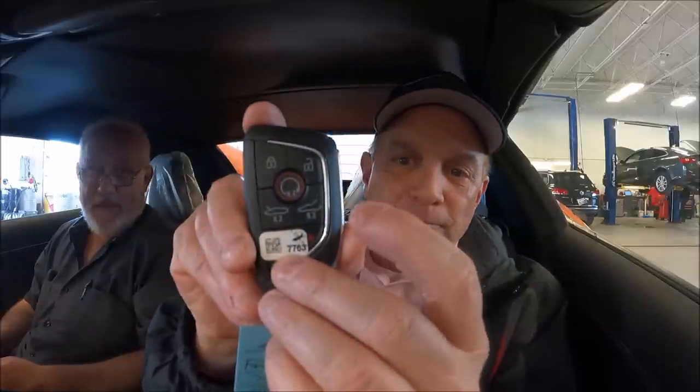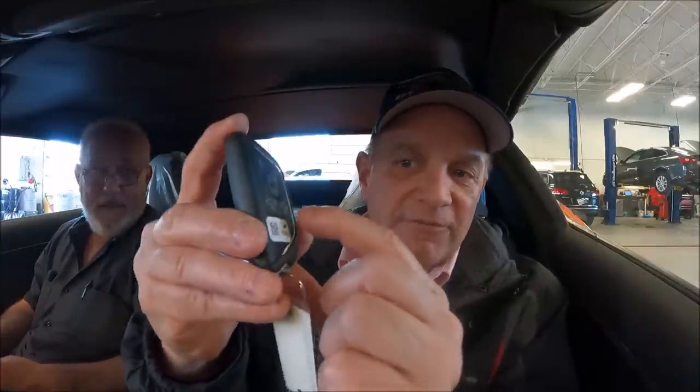Yes, absolutely. So in the scenario he described, and that's actually a good one too, we talked about this before for the folks that have lifts. If you've got the C8 on the lift and you're going to operate the convertible top, that thing opens way up. So she would have to hit the unlock button two times and press and hold this button. She'd have to physically hold that button down to get that to operate, and any movement will interrupt that and stop it from operating.